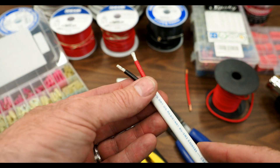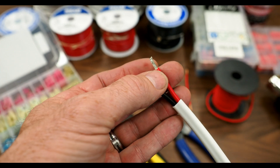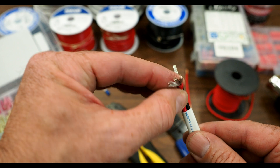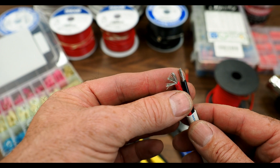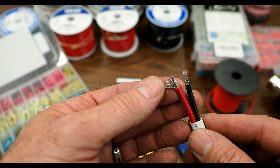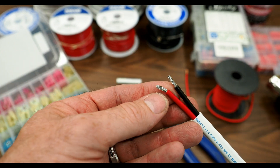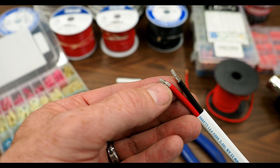In contrast, you've got marine grade wiring. Marine grade wiring is basically the same thing — individual copper strands twisted together with insulation. But you can see the copper strands are quite a bit thinner than the automotive wire. The thinner the individual strands and the more of them, the more flexible the wire is — so this one is really flexible if you need to bend it around corners. Each individual strand of copper wire is run through a solder bath and is 100% tinned before it is twisted together. By pre-tinning the wire the full length, it makes it very corrosion resistant, so when water or salt gets in contact, you're not in direct contact with the copper itself.